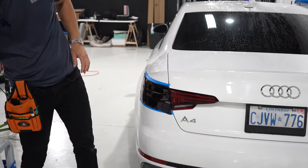Let's do the very bottom edge here. I always start in and work my way out. When it's a little bit too wet it's hard to do sometimes because the film is still sliding slightly. If I keep enough tension on it, we're good. That's why I said let it dry — because you might not be used to adding tension to the film and cutting at the same time.